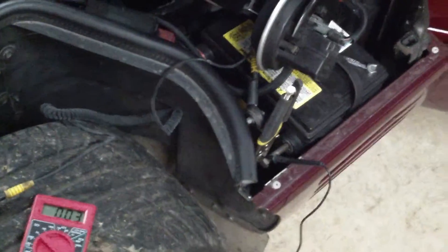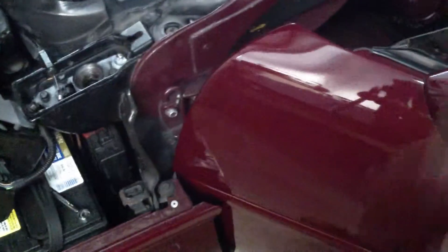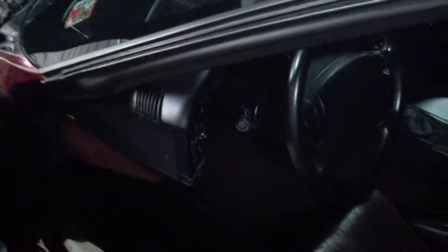Lead acid battery — you keep it charged and happy, and it keeps you happy. You abuse it, and it abuses you back. I left the door open. You couldn't do this so much on a newer car, but older C4s, there's no issue. Key out of ignition. If you had a voltage draw, you need to start pulling fuses — start up here with the maxi fuses until your reading goes down, then proceed to the interior. If you don't see anything there, put them back and go to the interior fuses. Keep pulling them until your draw goes away.